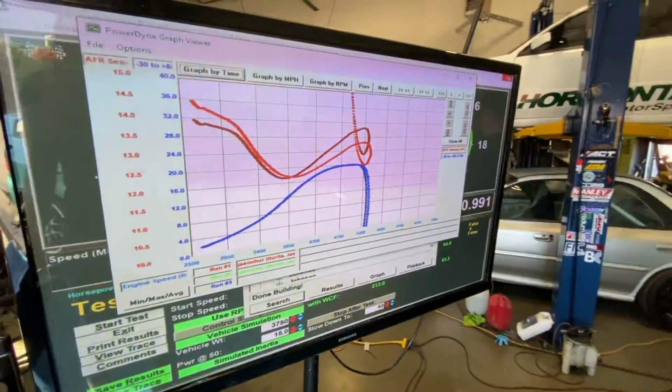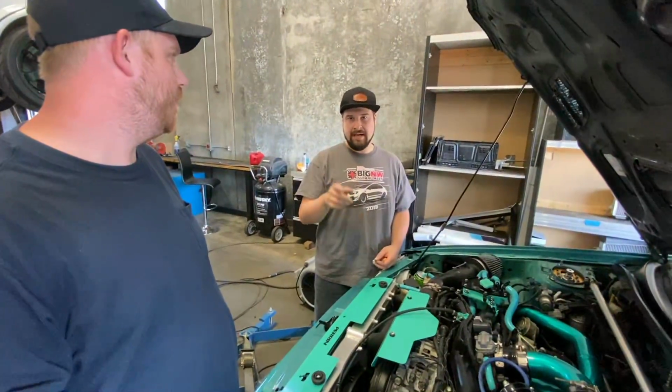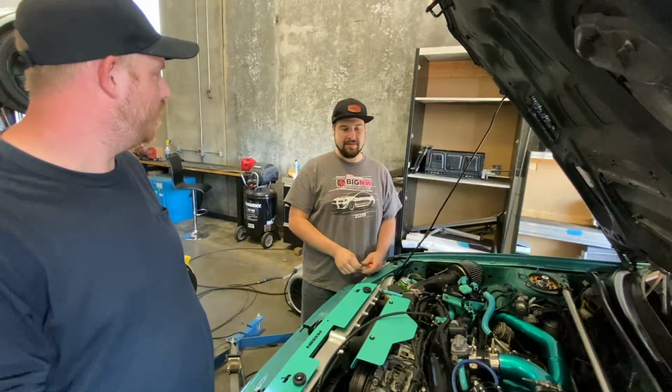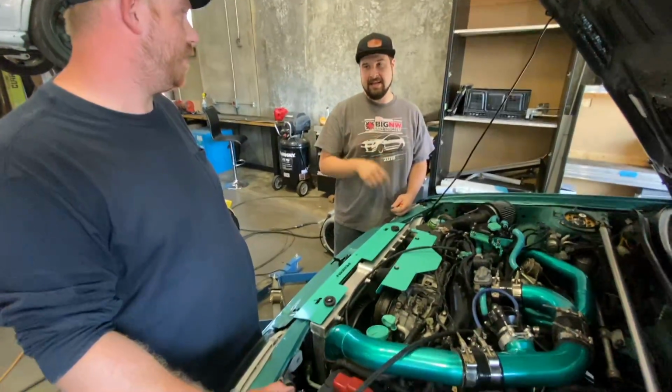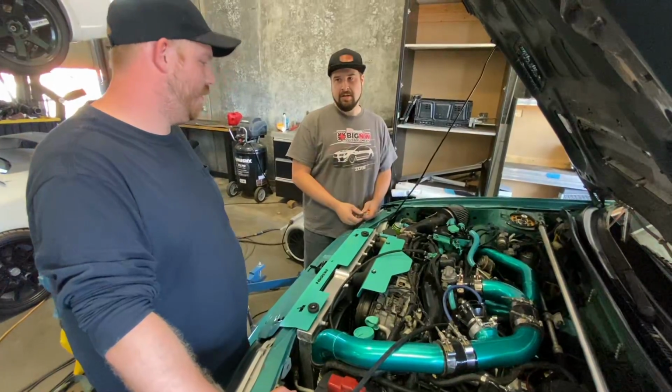Fuel curve, how it's just going straight up to run. Yeah. I literally added like 20%+ to the VE table, and it didn't really help much. It's still doing the same thing. Injector duty cycle is already over 80%. These injectors should not be at 80% at that little amount of power. Right. So that tells me there's nothing behind them.